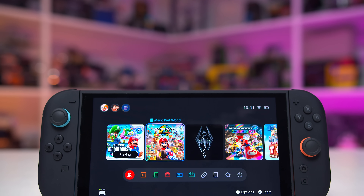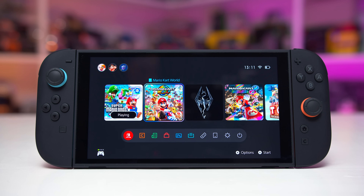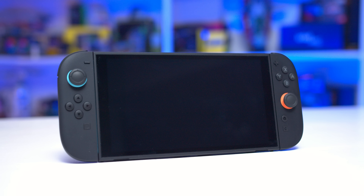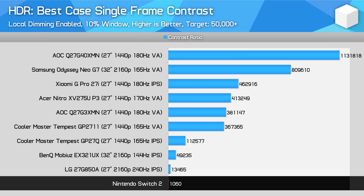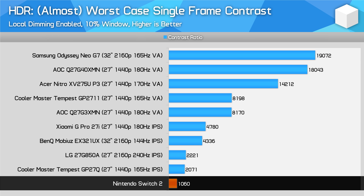The screen is wide gamut regardless of whether you set it to use HDR or not in the settings. One of the more controversial aspects of the Switch 2's display is whether it actually supports HDR. Technically it does accept and display an HDR signal, but from a hardware perspective this is not an HDR-capable display — it simply lacks the required hardware to properly display HDR content. The main issue is contrast: the Switch 2's LCD has a poor native contrast ratio and no local dimming whatsoever. This means in HDR content the maximum local contrast ratio is around 1060:1, whereas for the best HDR experience you'd need a contrast ratio exceeding 50,000:1.